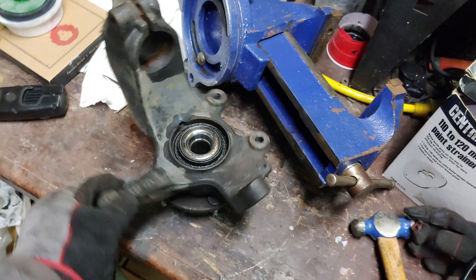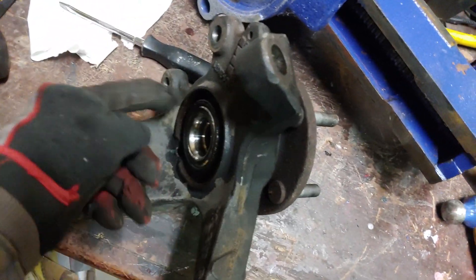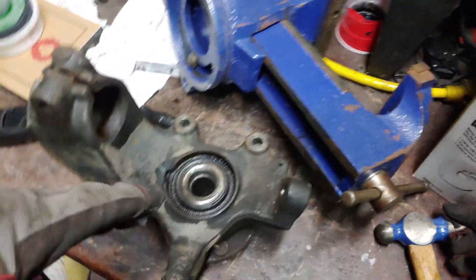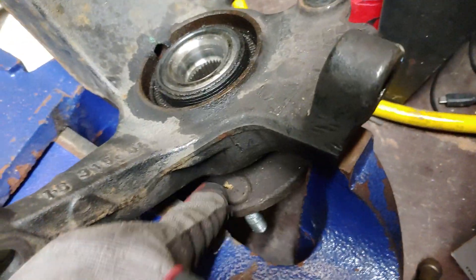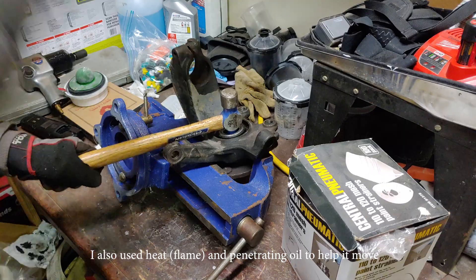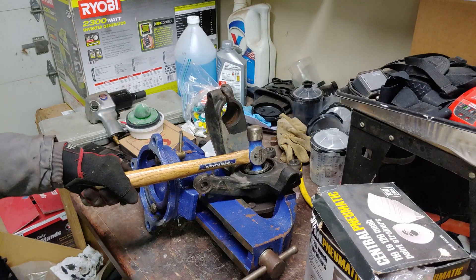Today's the second day of this adventure. I got the steering knuckle out. It was pretty difficult because the bolts have been in there for 16 years. My plan for removing this whole hub assembly is to hammer it out because I saw someone else do that with this exact same car. They put it in a vise — they had a bigger vise. They could set it in the vise normally and just hammer it out, but this vise isn't deep enough. There's nothing underneath this, so I can just hammer this out. After this, I got someone to hold the smaller hammer and I hit it as hard as I could with the sledgehammer and it just wouldn't budge.